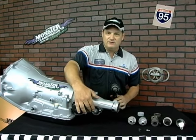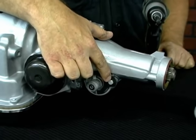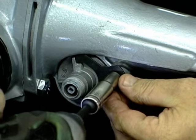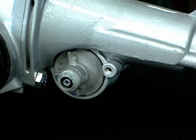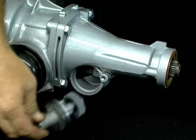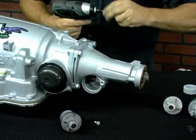First of all, you'll notice you have a housing with a fork bracket and a screw. This screw should always have a 10mm head bolt on it and the threads are metric. We're going to remove that bracket. Once the bracket is removed, the housing should be able to just twist to unsecure it from the case. That's your factory set of gears that came off your original transmission. Now we need to remove the extension or tail housing of the transmission.